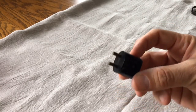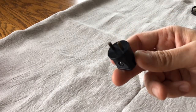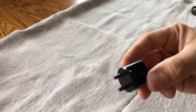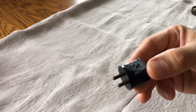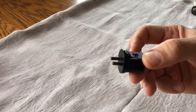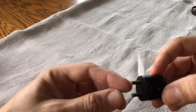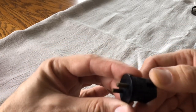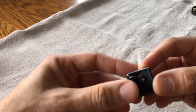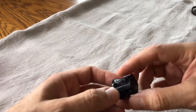I have another Singer 301 I'm getting ready — I love Singer 301s and all the Singer rotary hook machines, really. This is the plug end that connects the cord powering the foot pedal on a Singer 301, and just like a brown cord, if you pick this up in the light you'll see it has brass hardware inside its Bakelite shell. The cord was bad but the shell's not, so I'm going to hold on to it and reuse it when I wire up a Singer 301.